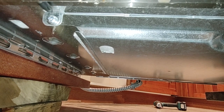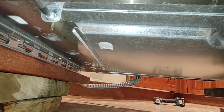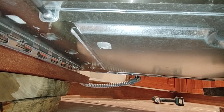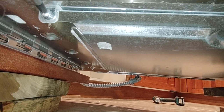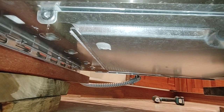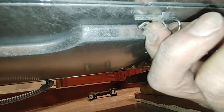Next, remove the one screw underneath that holds the panel covering the lower cook element in place. Okay, that's out. And then there's a little safety clip over here — with the obligatory dust bunny — and that just gets pulled out.